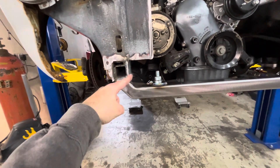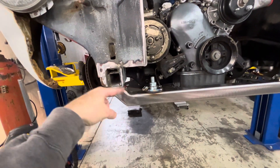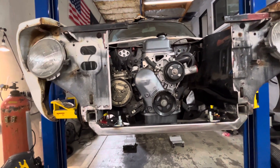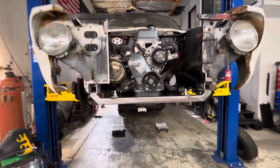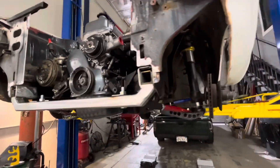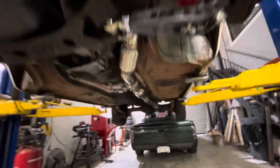I'll drop the tension rods and then weld them from the inside too. These bars are going to get gusseted to the corner plate here, so this will all get stiffened up a bunch. I'm going to make some plates to cover these up and do something to fill this in, because the radiator takes up the space perfectly — and the condenser obviously. That's what we got going on with the suspension. This thing should handle pretty well.